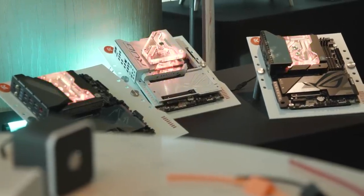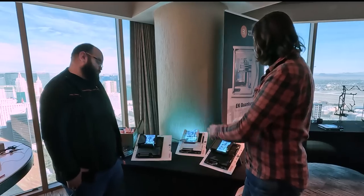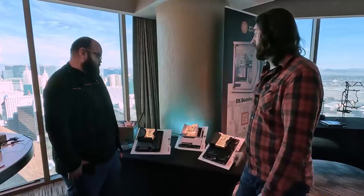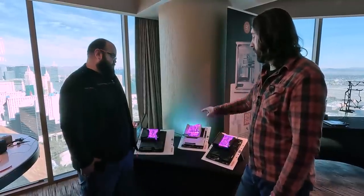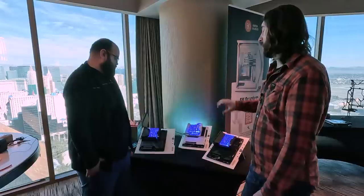Are these all Matrix 7 compatible? Yes, all three align the ports in exactly the same position, so you can make the horizontal connection to any Reflection 2 or distro plate. You just need a 28mm extender on these and a 7mm extender on the Formula because it's much higher when you stack the blocks.